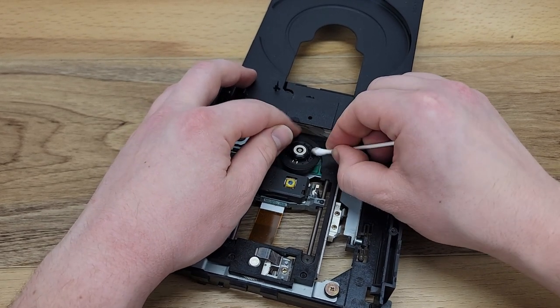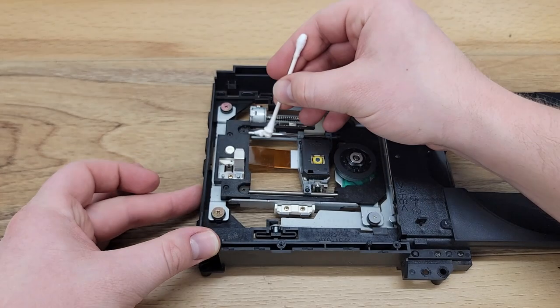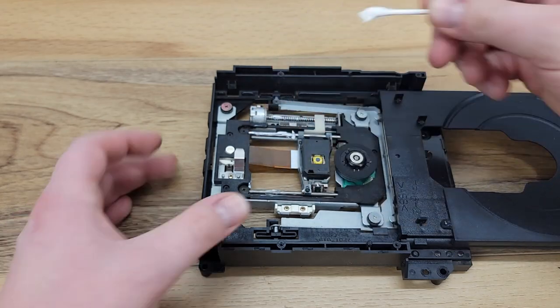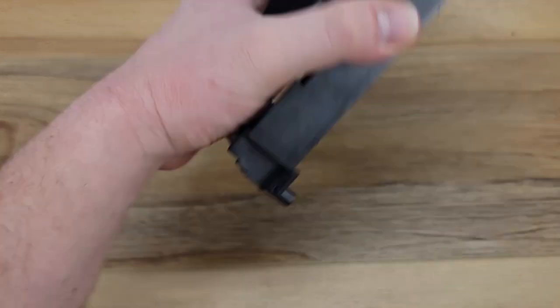Now, using white lithium grease, we can lube the slides, the motor screw, and anywhere else that we removed grease from in the previous step. I like to first apply and then actuate the assemblies and then clean excess off after that.